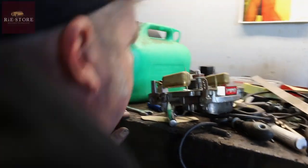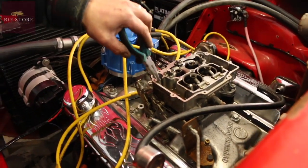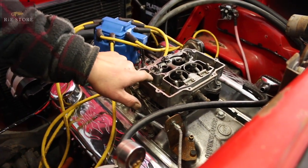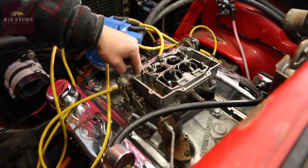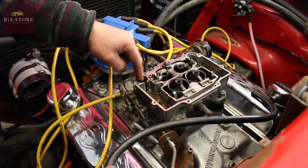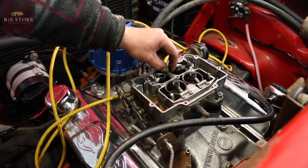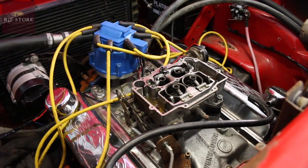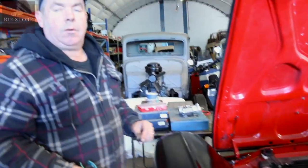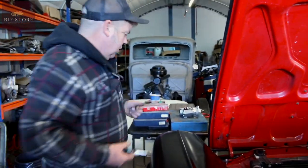That's good - that's about 10mm. See that slot there - your fuel level should be high enough for the fuel to spill into that slot. And then your accelerator pump goes in there. Obviously if there isn't enough fuel in there, then it squirts down through those two jets, which we were looking at through the top of the carb. So if there isn't enough in there, it can't squirt it. But that fuel is still as shit.